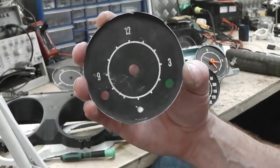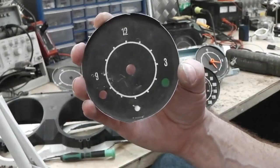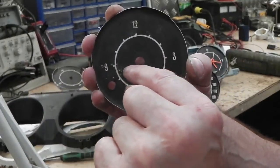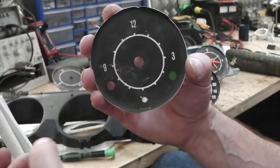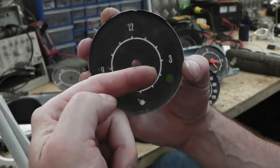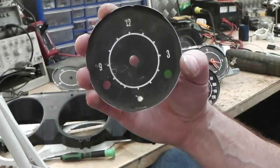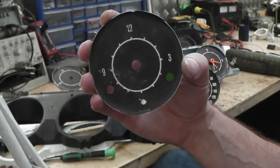And I got the idea from a Vulcan bomber, would you believe, and they're called doll's eyes. On a Vulcan bomber, for the pilots, a lot of the indicating panels are done with a little solenoid and a white bar. When a solenoid activates, it pulls a bar, and they're used to line up. They become like a line, and if you had four of what they call doll's eyes, the lines all go in a line. And if the solenoid deactivates, the spring on the solenoid allows the line to flip the wrong way, and you don't get a join, and the pilot can spot things quite easily. And at night-time flying, you don't have these lights flashing at you, but you've got a physical representation of what's going on.